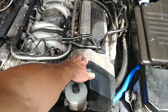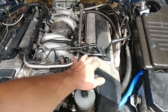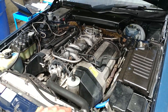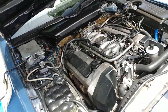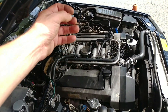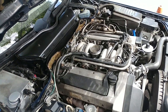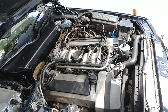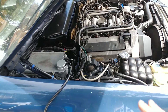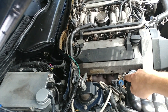In terms of the engine, I hear a little noise on this side - like upper guides or inner guides - it sounds like a little bit of chain slap, which is not the greatest sound. I'll need to figure that out, maybe take the cover off to inspect it. But it has to be done on a cold engine because you disconnect fuel lines, and fuel on a hot exhaust is bad.